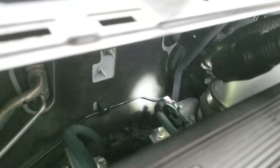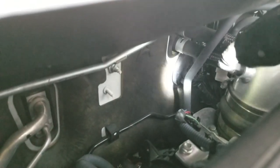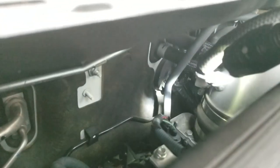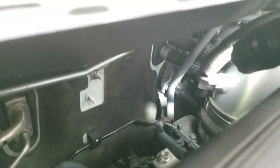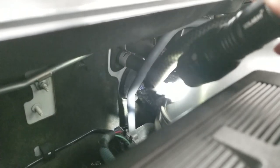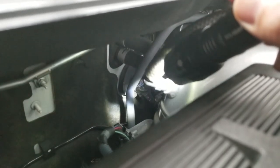Now the one on the driver's side, above the accelerator pedal, is right here in the engine bay, just below the heater core hoses. This one is not going to move — you're not going to be able to pull it into the car to trim the end of the nipple off, which you can see right there. So if you have a strut bar, you're going to have to remove it and then reach down there with a pair of cutters and trim the nipple off.